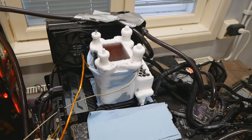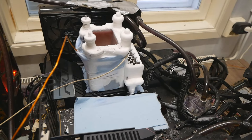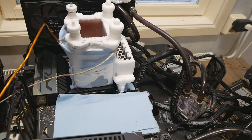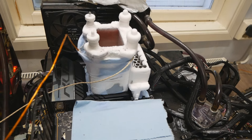Serpman from Germany managed to do a bit better with his stick, getting up to 5700 MHz which is DDR5 11400 megatransfers per second. The world record level is at 5824 MHz — that's DDR5 11650 — by HighCookie and a guy from Hong Kong. I managed to improve the end result a little with this third CPU, but I may be hitting an IMC limit. It's hard to say whether it's the memory, the CPU, or the board, as boards do vary a little for memory frequency validation.